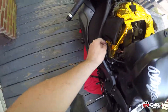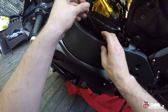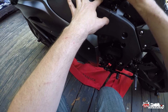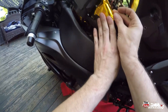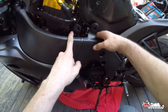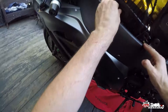This is my Pod 300 wire here — I kind of just put it in there because it's not exactly where it's going to be mounted yet. I didn't want to go up over here because the throttle cable is right there and you don't want that rubbing against it. So I used this bracket right behind the airbox to keep it up over here, and that'll also make sure that when the tank is lowered it's not rubbing on that wire. You never really want any cables hanging anywhere on your bike — everything should be neatly zip tied and put away.